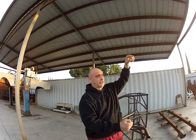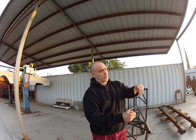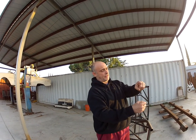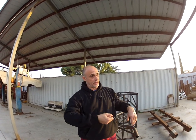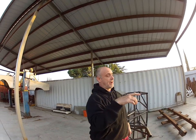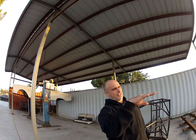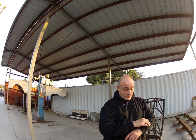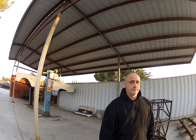Yeah. Your instant center, you've got to set way high. If you get your instant center set down low, and you're carrying a short stick, and you take off, the stick doesn't go back very far. And that's what makes the tire spin, the short stick. The tire spins like crazy. The tall stick is sticking and the whole front end comes up. And you want to find that one sweet spot, where you just carry the tires for about 60 feet, and she sets back down. And you want to do that on the street, which is insanely hard to do, because every spot's different. The pavement that you're running on is different.